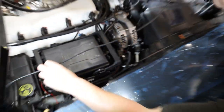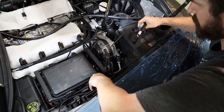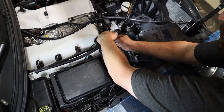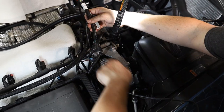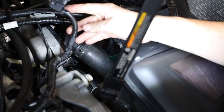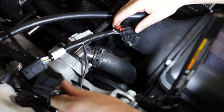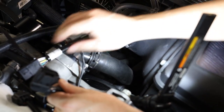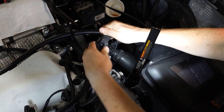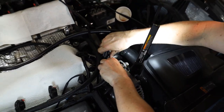Route this harness coming up from the back and run it along the side. It's a little on the long side for a Corvette specifically, so you may have some excess to coil up — but it was designed to work on both Corvette and Camaro applications. Simply disconnect the MAF meter, then the connector goes directly onto the MAF meter — lock to lock. The connection on the other side gives us the raw MAF signal needed for this controller, as well as a power switch to know when the key has been turned on.